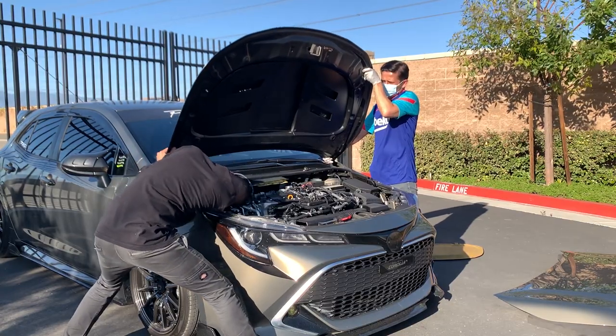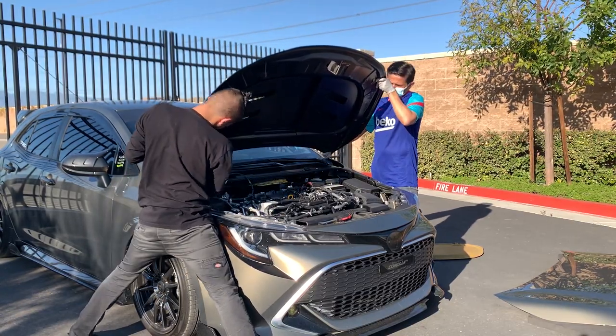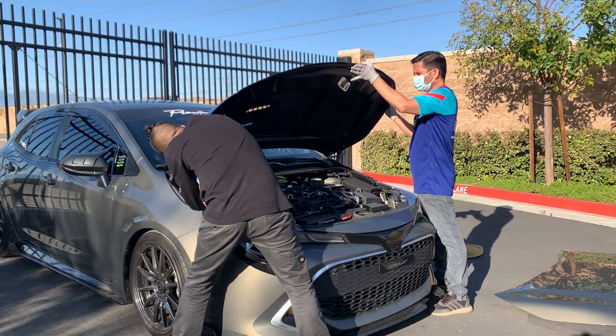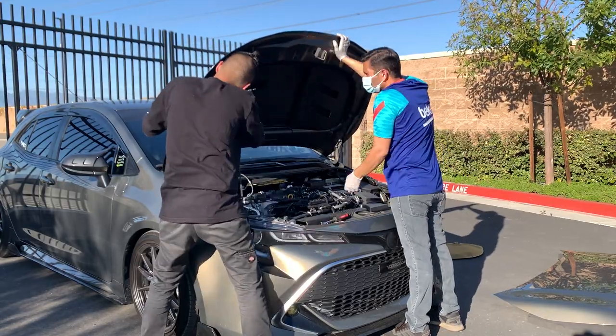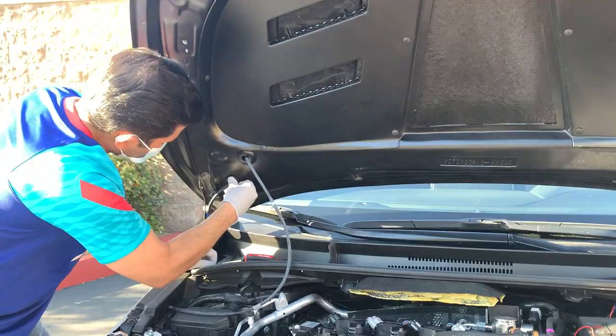And there are videos on YouTube that I've linked down in the description that I found helpful if I were to do it alone. But what I did is I angled it and aligned the bolts to the holes they go in. And I just finger tightened them to the point where I know the hood's not going to come off. And then once that's done, you start putting the hood prop on. And the hood prop's super easy to put on.